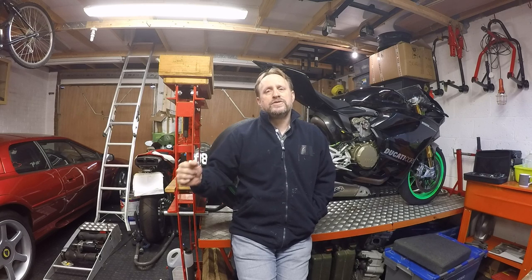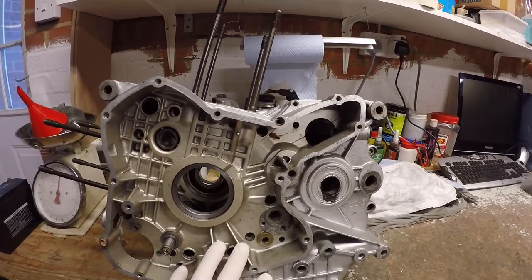There's some stuff I know I'm going to need straight off: new main bearings, new gearbox bearings because the cases are from an unknown source, and new big end bearings because the engine was run for a season before this strip-down. I'm also going to need a gasket set. So what I'll do is check for everything, show you that process, pull together the list of parts I need, and get those ordered up. Hopefully for the next video we can get to the point where we just start putting the engine back together. Let's get into that.